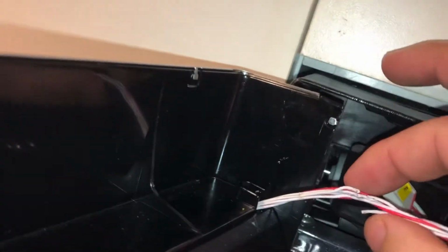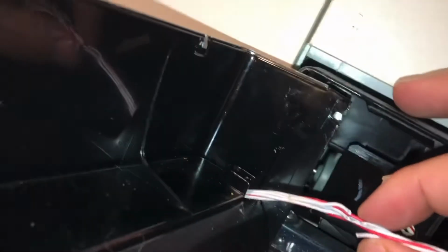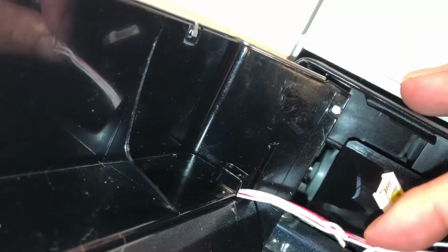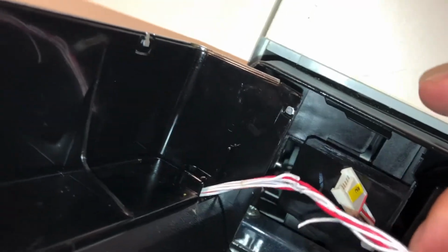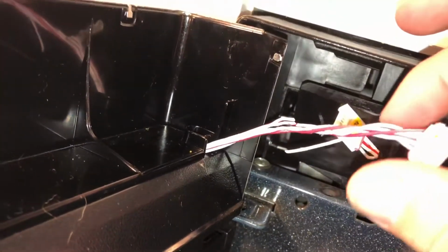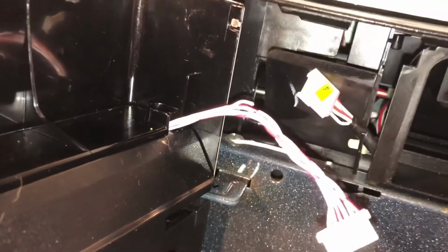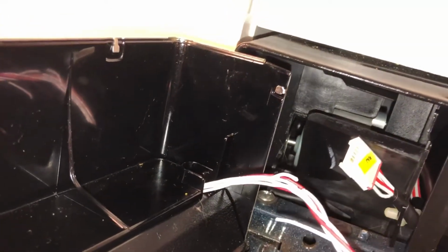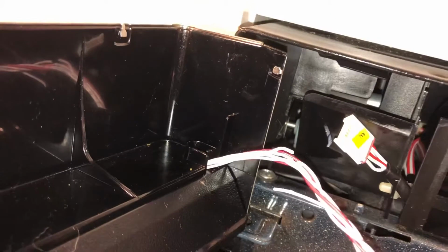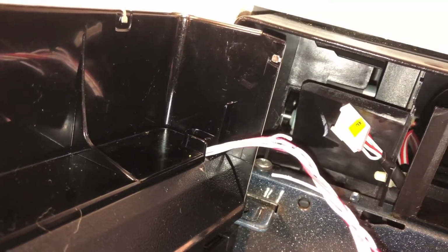I am back. The tape has been taken off. Looks like I've got two white wires that have been severed. Looks like the other four wires look okay, but hopefully those white wires, I guess I'm going to have to play it's a 50-50 shot if I get the right wire going to the correct severed wire. So I've got to strip those back, tie those together, and wrap it with electrical tape, see what happens.